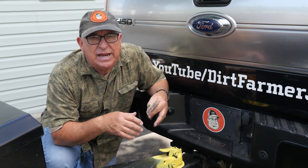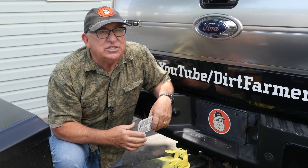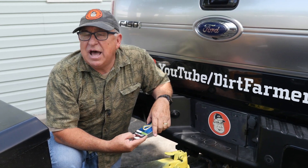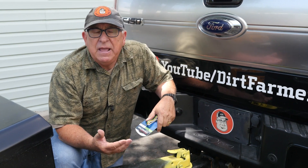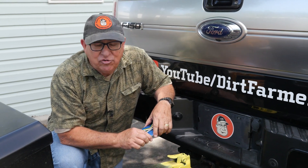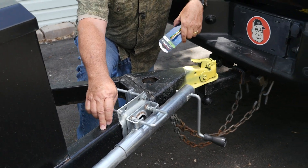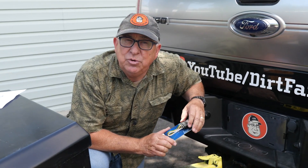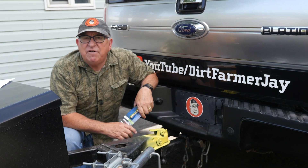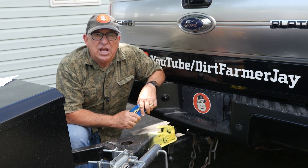— butt connectors, soldering, terminals, that sort of thing. There's plenty of material on YouTube if you need to learn those skills. We also assume that you know wires are not left dangling on the undercarriage of the trailer and need to be secured wherever you route them. One of the best places to route wiring in a trailer is inside the tubing that trailers are made of — that's the best protection. And any place that you enter or exit that tubing or any metal portal, it's best to use a softening rubber grommet to stop the wire from being chafed or cut.